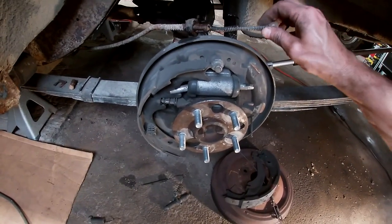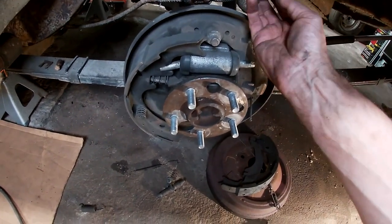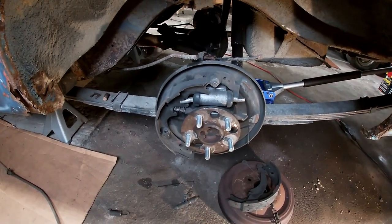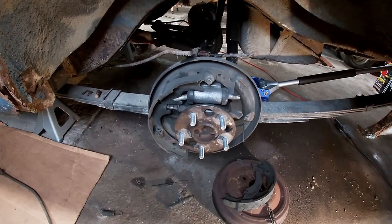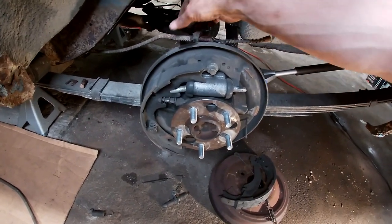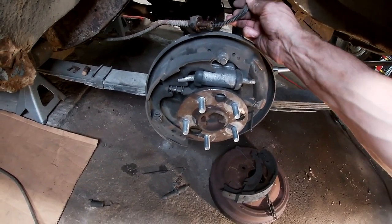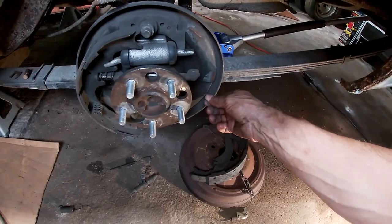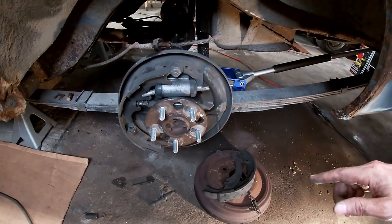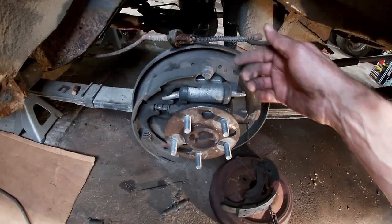so you can just get the cable on the shoe. Well, these e-brake cables work, but in order for me to pull it out so I can move this spring back, the front cable is kind of seized up. So I have to really work at it to get it off the little bracket up front so I can release it to get it where the spring is not tight like this. And then in order to put the shoe back on with the retainer here, I have to put it back on to the seized up cable. So I have to pull it myself, which is, yeah, there's a lot of swearing going on. So I'm gonna finish this up and then move on.